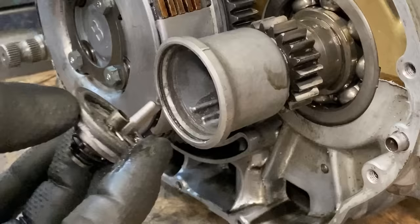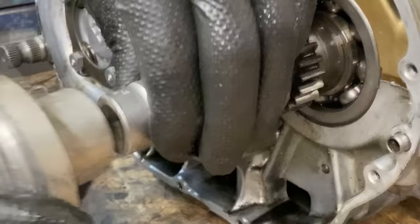With the cover drying in the sun I go back in the garage to reassemble the oil filter. You must line up the protruding tongue with the groove to prevent it from slipping round. Give it a little tap to make sure it's seated down, then replace the circlip with the pliers ensuring it's seated correctly in its groove.